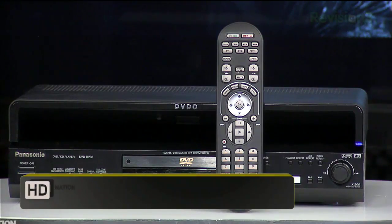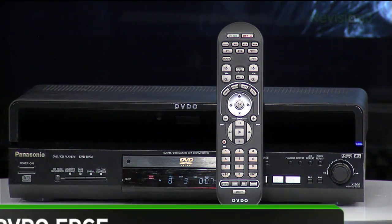So obviously a thumbs up for this product, especially at the reduced price. $500 though, so I would say if you haven't bought your receiver yet, and it's going to have Anchor Bay technology in it, or another quality video processing technology, and it's going to handle your switching, then for a couple hundred dollars more, you can basically get this built into an AV receiver. Very close to it, at least. This also makes it compatible with all the gear I have. I need optical audio out for one older piece of equipment, so I'm able to take analog audio input or HDMI audio input and have that convert to my one optical output. It keeps all my stuff working together longer, too.